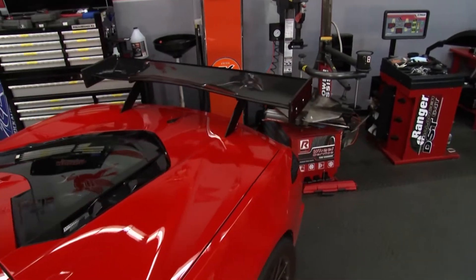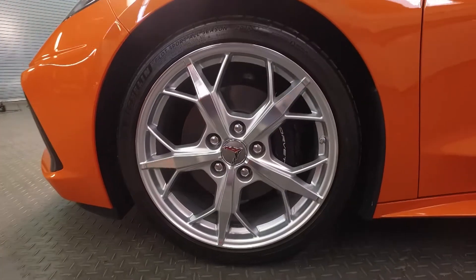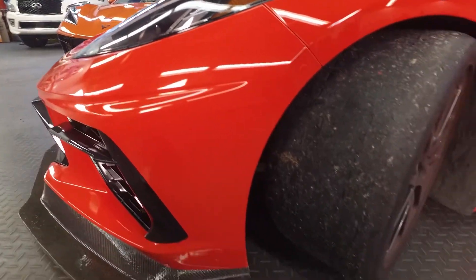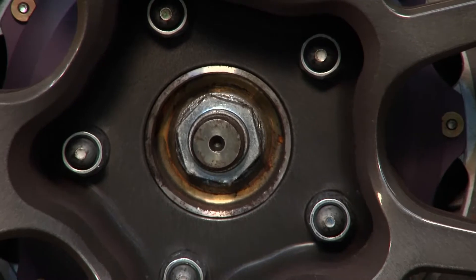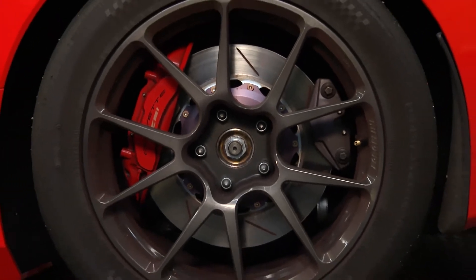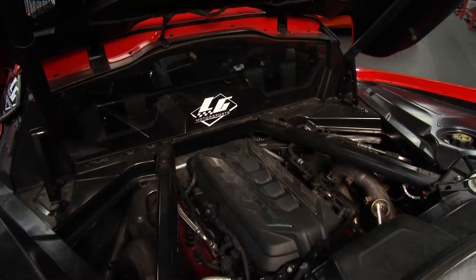It's not just the aero — you're also talking wheels and tires for better grip. The factory wheels and tires are a little bit narrow. We've gone to Hoosier slicks, A7s — 305s in the front and 345s in the rear. Those Hoosiers are a lot stickier, and you're able to run those tires because you have a lot stronger wheels, which we got through ForgeLine. A lot more meat means a lot more grip in the turns.